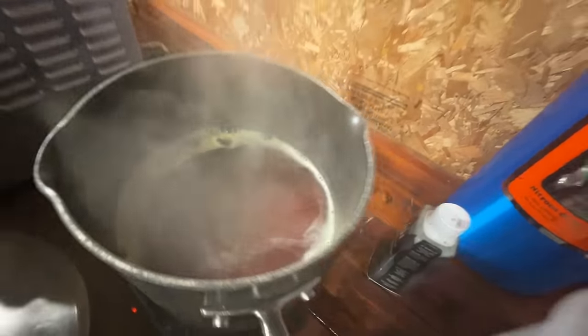There we go — look at that, how's that for custom? Looks like candy corn! Putting her back together now — this is the fast part. This little impulse line here goes through the case, and they always get kinked. I opened up that hole a little bit — the edge was really sharp and the opening was almost D-shaped rather than round. I've always opened them up a little so there's room in there, and I even put a bit of heat-shrink tape around it for extra padding.